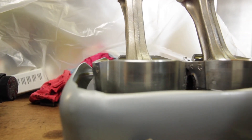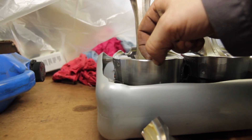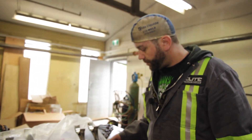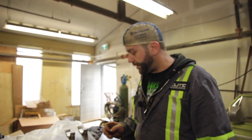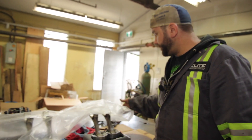The pistons are actually perfectly fine — you can see there's no damage to the piston at all. Even though it chafed the cylinder wall a little, it was probably right on the bottom edge where you can't really see it. We're going to reuse the pistons. There's only 70,000 kilometers on this engine, so we're replacing the connecting rod bearings, the crank bearings, and the cam bearings, but reusing everything else because it's perfectly fine.